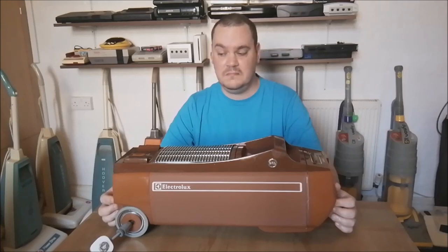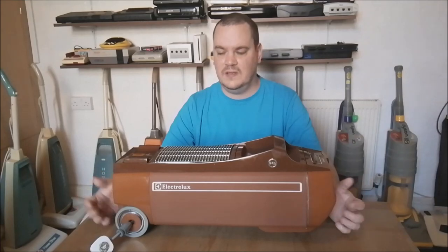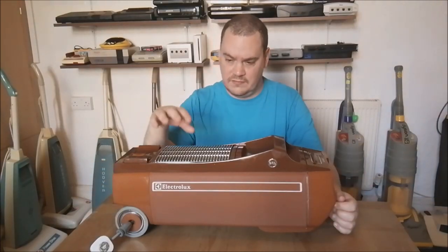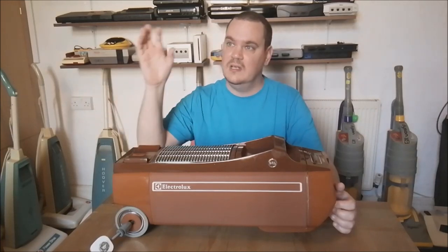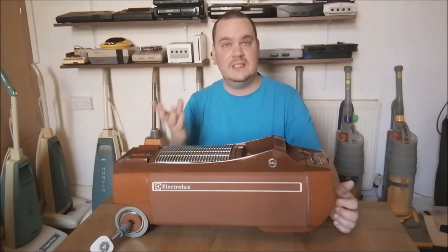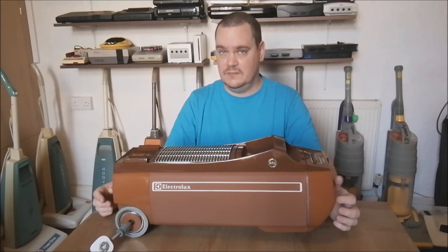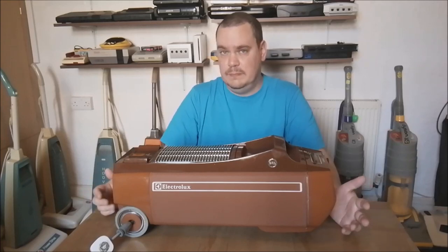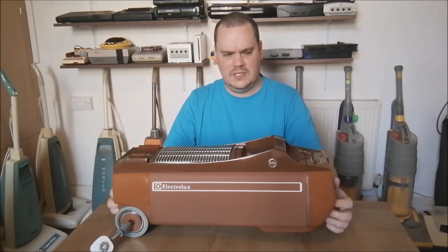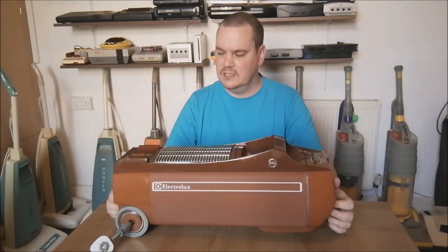And most of the time, you could fix them. The only thing that really kills these off is if the motor fails. And as I've shown you in previous videos, 345 uses the same motor as 330, as 350. It's that semi-sealed Electrolux unit. And the only thing that ever really kills them is if the top bearing goes or the bottom bearing goes. But they're really good, hardy motors, so they went on for years. Obviously, this one has been retired for some time.